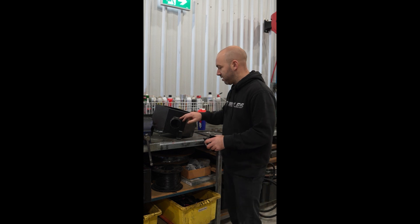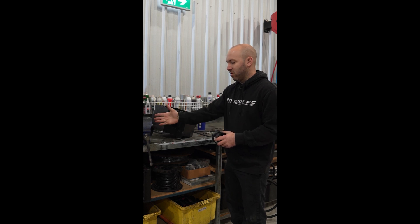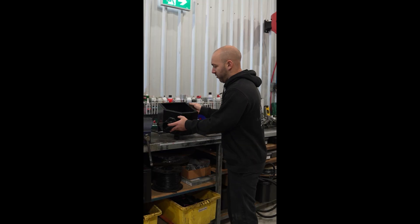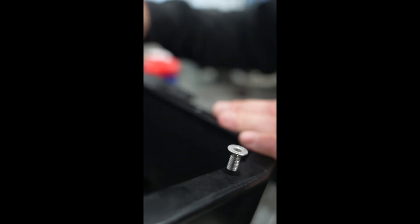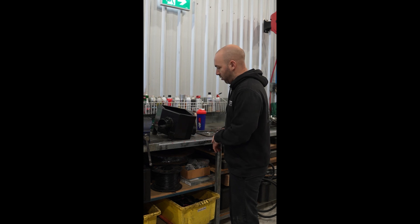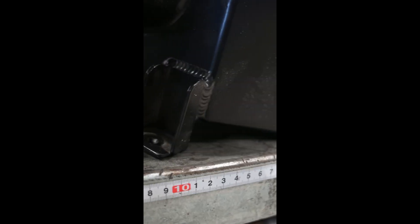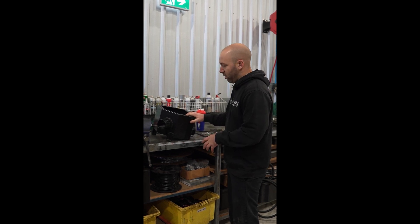This one has no air straighteners, no podiums for the airflow meter, and it's been ground out here because the radius was too tight — it was restricting the inlet pipe by about 50%. It's also been cut out by hand, and you can see how thin the aluminium is and how close the threads are to the edge — we run around 8mm there. It didn't have a gasket either, just double-sided tape which all ripped off when we pulled the air filter out. There are also no rubber insulation bosses, so it's more prone to cracking from vibrations.